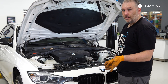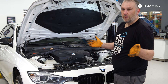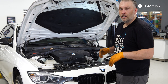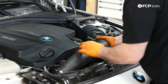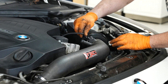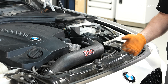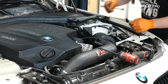Now that the radiator fan is back in place, we can reinstall the intake. It's an aftermarket intake on this car, so it won't look 100% the same as stock, but the connections are generally the same. Plug in the mass airflow sensor, make sure everything is secured properly, and the hose clamp for the inlet pipe is tightened down. The last thing you want is a vacuum leak on your intake — it will run lean and probably misfire. Take your time and do it right. Seat the intake pipe — it kind of clicked into place — drop the heat shielding portion onto its mounts, plug in the mass airflow sensor, then tighten down the hose clamp and reinstall the 8mm and 10mm fasteners.